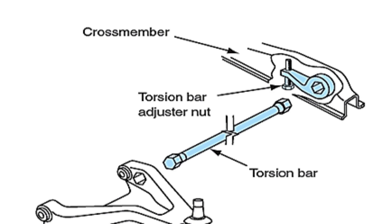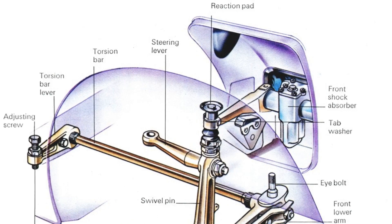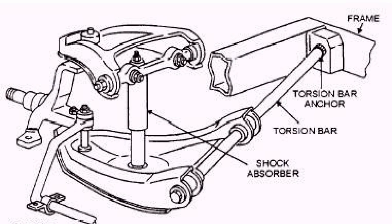In this type of suspension, up to five arms are used to attach the hub to the carrier, depending on the purpose of the vehicle. Among the advantages of multi-lever suspension are more precise vehicle handling, greater system reliability and long uptime, and stable maintenance of the tread contact patch with the road surface. The disadvantages are shorter travel than a single-arm system. Therefore, driving a car with such suspension is less comfortable and accompanied by a lot of noise. This suspension system is most often used in sports cars that drive on flat roads and have higher demands on handling and lower demands on ride comfort.